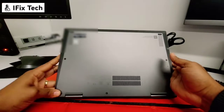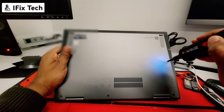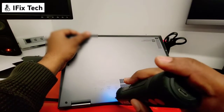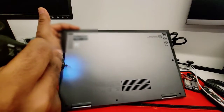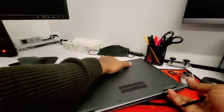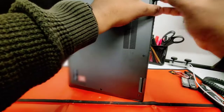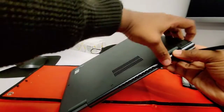Let's get to it. On the back you will see it has 5 screws — you want to remove those screws. You can use a phillips head screwdriver or a star head screwdriver, whatever they call it on your part of the planet. Now we're gonna be using our plastic tool to pry open the machine. I normally do it from the backside — this is how I recommend you to do it.